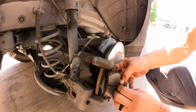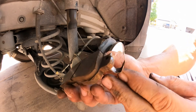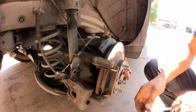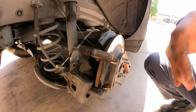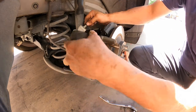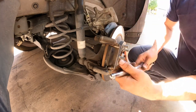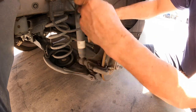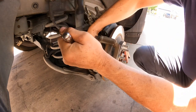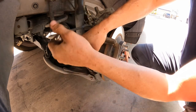That's why we're going to replace this — it's thinner here and bigger there. Usually when that happens the outer brake pad is wearing. I want to have a maximum amount of stopping power, so we need to fix this. Now we're going to move this to the side and use our 14 millimeter to remove the caliper bracket.